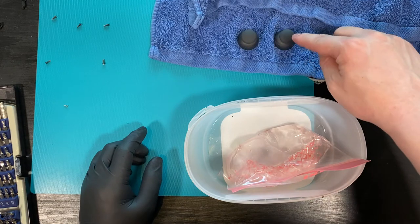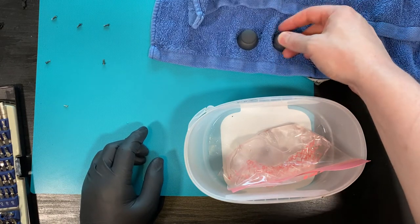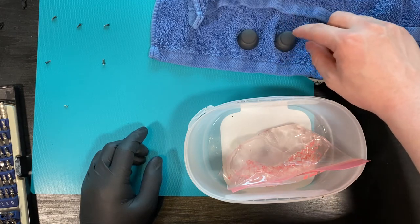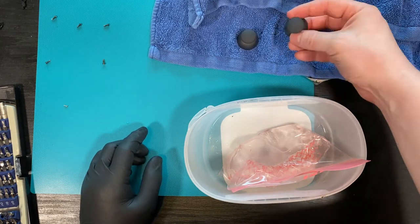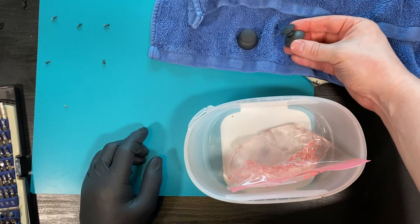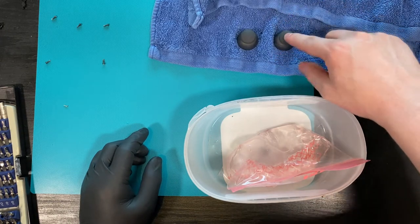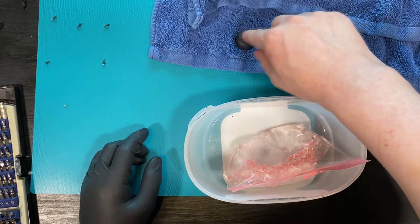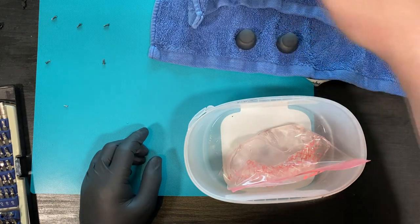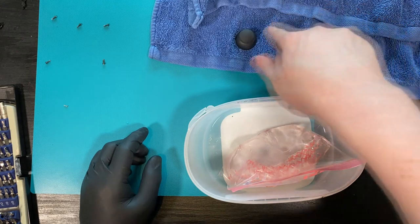Now, usually these kind of rubber things, if you use IPA, it'll peel off the stuff. It starts to degrade. But at least in this case, for some reason, the six-axis analog sticks, when submerged in IPA and used in an ultrasonic cleaner, will clean off the stickiness, and these are like new. So now the only thing I need to wait for is the other parts to dry, and then I can reassemble this thing, and this is essentially as good as new.